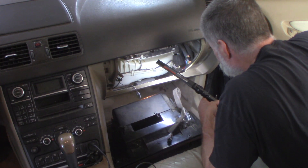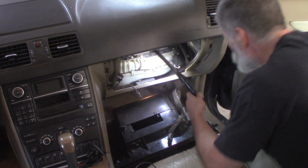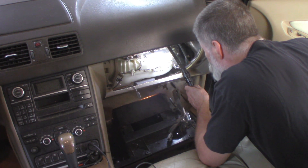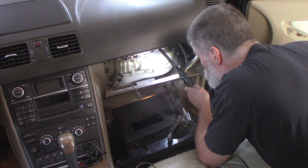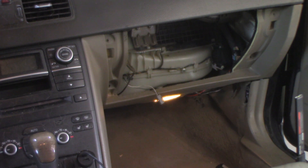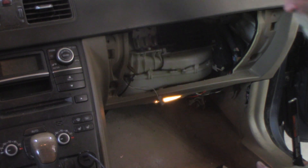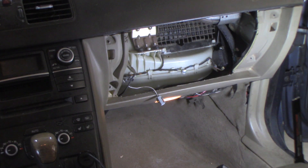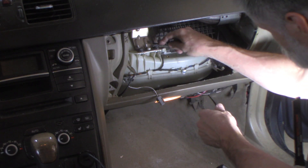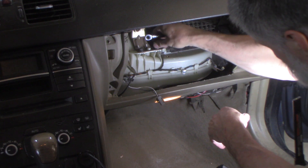The blower motor is in here, probably down here. Right here - yeah, this is a connector down the bottom. Oh man - that looks like rodent damage. There's a rodent chew there - chewed right through it. That's what it looks like to me. Okay, so let's go underneath here and see what's involved in getting this blower motor out. There are two bolts up in here on that bracket I think I'm going to loosen, because I think it gives me a little more leeway. There's a screw right up against the firewall that's hard to get to.